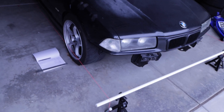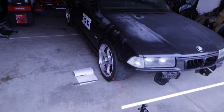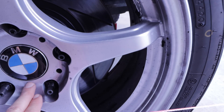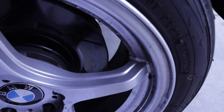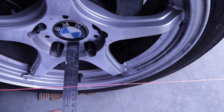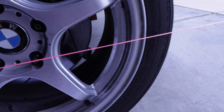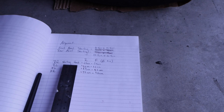Now that I've got the whole jig square and took my initial measurements — measuring from the center of the tire in centimeters, looking straight down — it's 11.5 centimeters in the front and 10.5 in the rear. I'm taking all my starting toe measurements and noting them down.